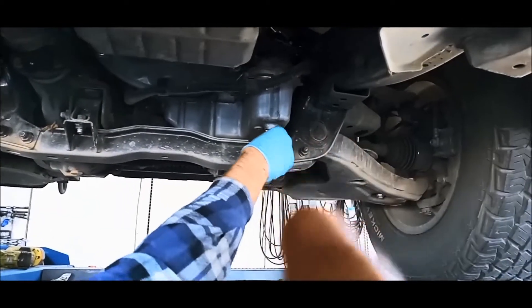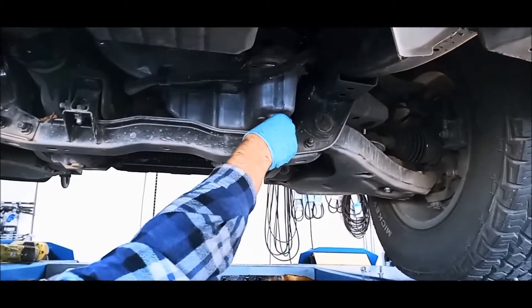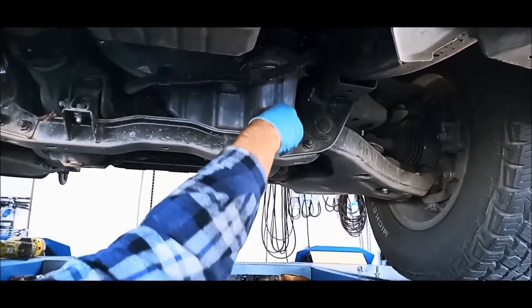You just keep pushing the plug in into the thread until you're ready to pull it out, and that way you'll make less mess. While that's draining, good idea to check the rest of the stuff under the car — rear shocks, unis, check if you've got any grease nipples on these. We're going to change the oil in the transfer case, the rear diff, and the front diff.